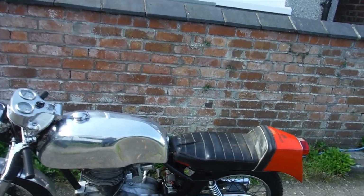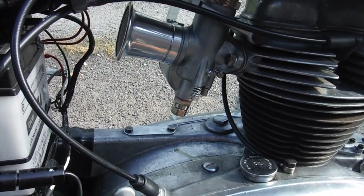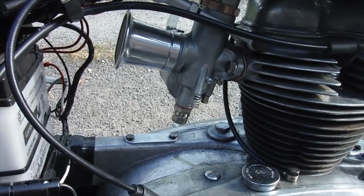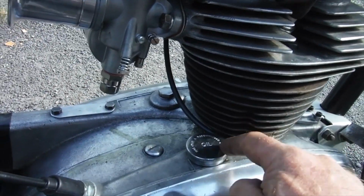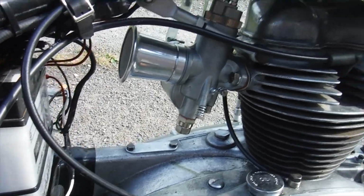So probably adjust that out, but it may affect the selection of the other gears. Hopefully not. There's a little linkage inside behind this cover with a turnbuckle threaded adjuster on it, and even half a turn can make a tremendous difference. It's that hair triggered and that fine, the adjustment. We've also got a little bit of an oil leak there to deal with, but it kept running, it ran okay. No nasty noises or anything.